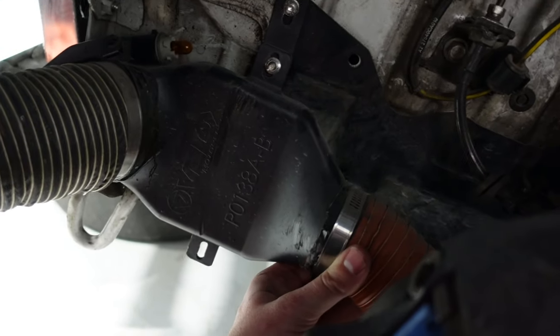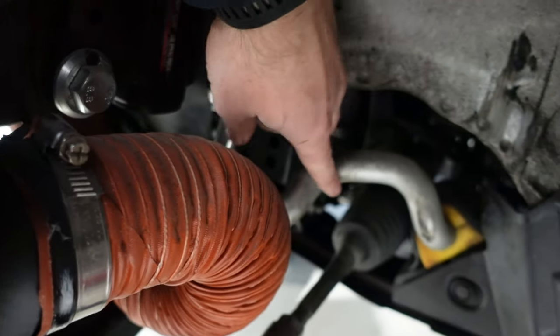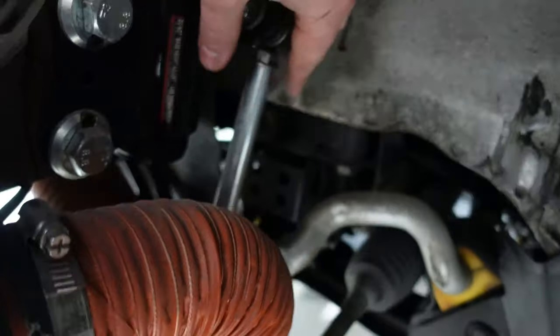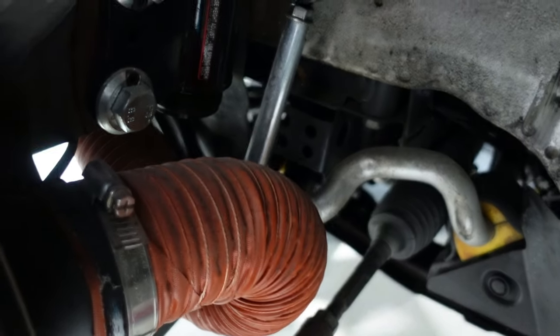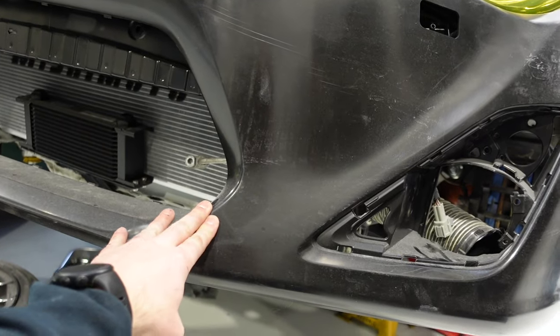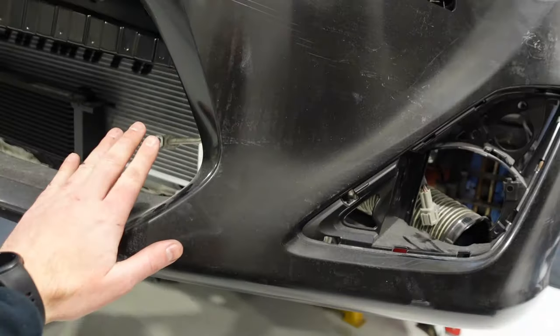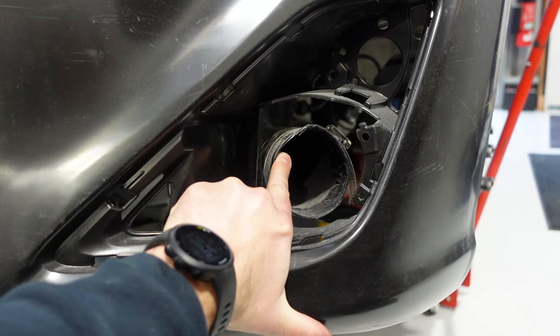It's quite a big challenge to package all of the ducting inside a wheel guard like this — this space is always at a premium. There's not a lot of room, particularly when you allow for all of the suspension to move up and down, and you don't want the brake duct coming into contact with any suspension components because it will chafe and eventually cause a failure. When looking for a place to feed that cold air from, it's pretty important to consider where you take it from at the front of the car. You need to take it from as high a pressure area as possible — that usually means somewhere on the front face of the bumper where you've got a relatively direct line in for the air. When sizing these ducts, you typically want to go larger rather than smaller, because different ambient conditions or how closely you're following other cars on track will change your brake cooling requirement.